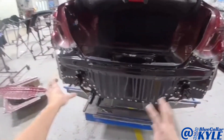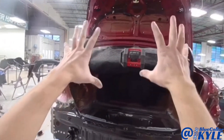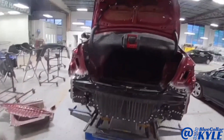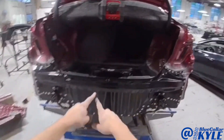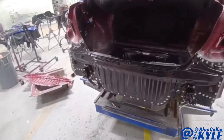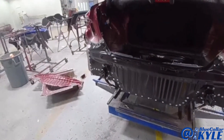This one is measuring out perfectly now, so everything's sitting where it's supposed to. I've got to fit up the taillights and fit up the lights in the trunk lid, and make sure everything fits correctly when I shut the trunk lid and latch it and check the seal. Once I check all that, then I will go ahead and start welding this rear body panel on and get this one finished up.